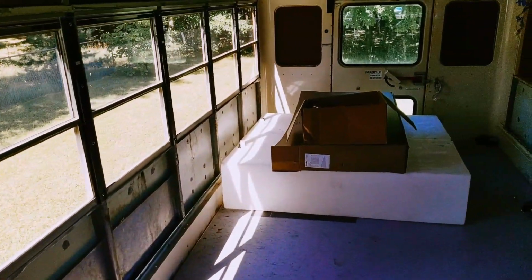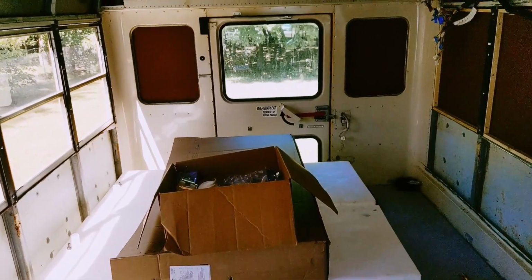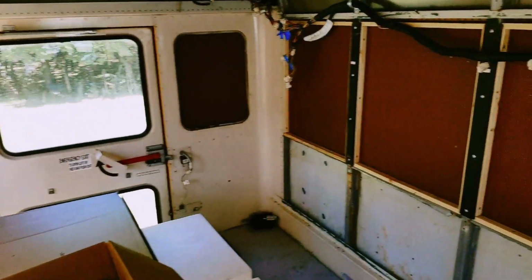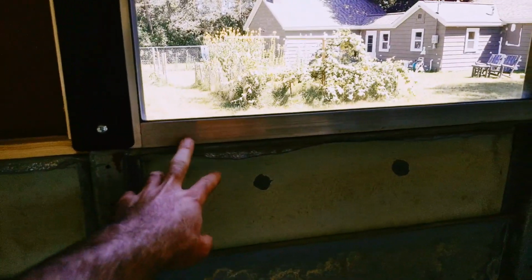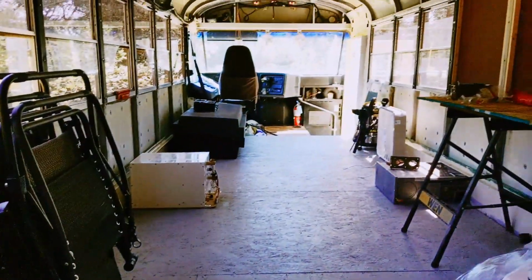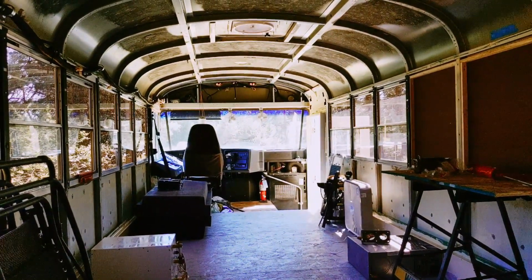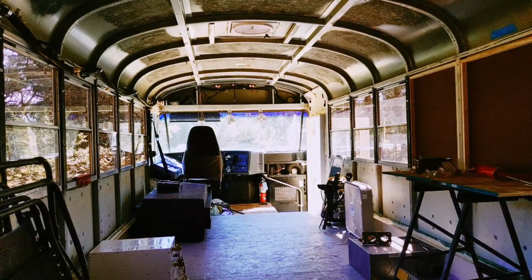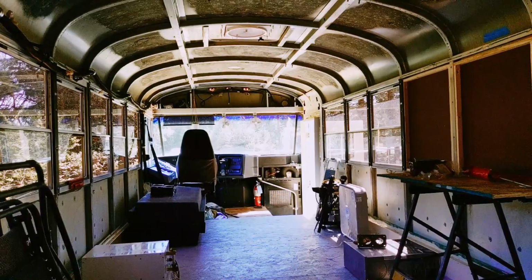And for a little bit, one of the last rains we had, we did have some water in here before we did the roof coating, and we were kind of frustrated. Also, all the windows were getting water down in here, and we didn't know why. But on the roof, I went and put sealant over every single rivet, and then we have, like I said, 7 layers of coating up top: 2 primer, 3 for the insulative coating, and then 2 coats of clear.